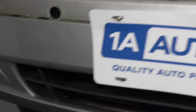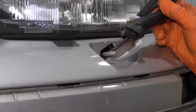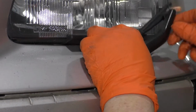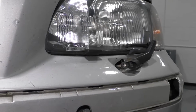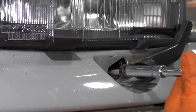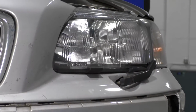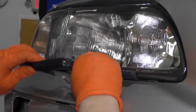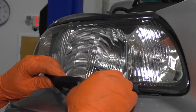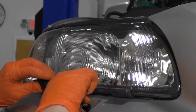Let's do the same to this side. So I'm going to make sure that, see, the hose is now free flow and it's not riding against that regulator arm, so if they turn it on, they don't rub the hose. Flatten that out. Take the mounting nut. Start it. That is an 8mm. Push the cover down. Do the same to the other side. Reconnect the hose. Bring it down inside. Make sure it's out of the way of that regulator. I want it lined up just right.